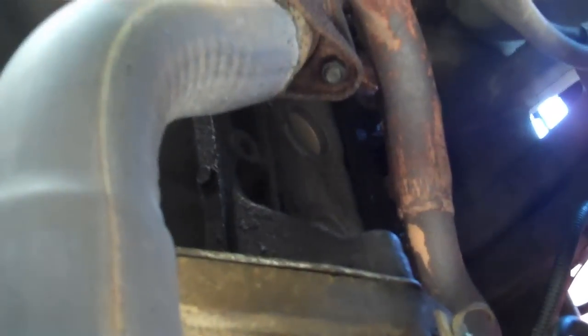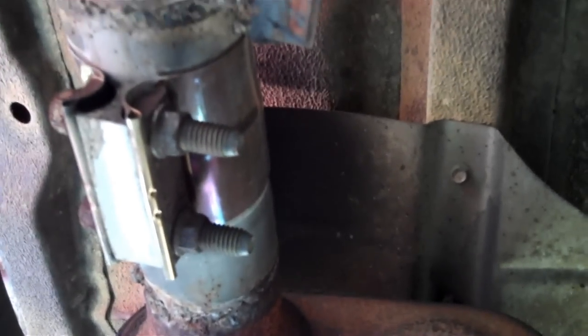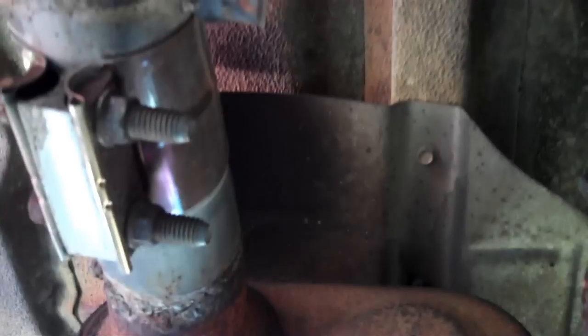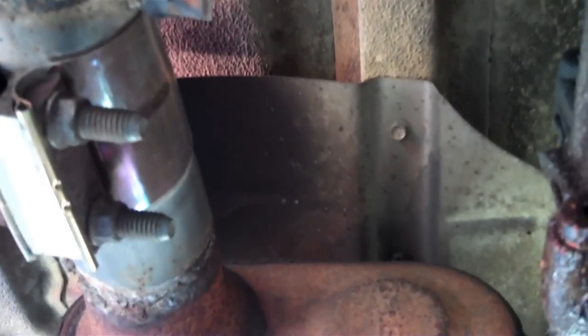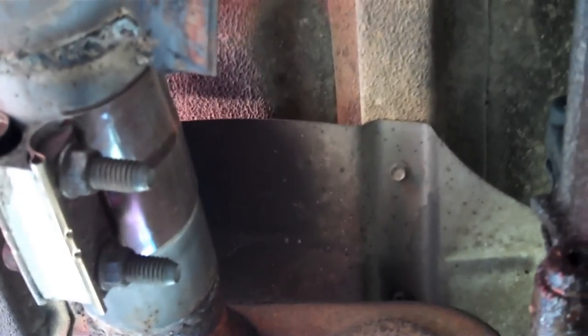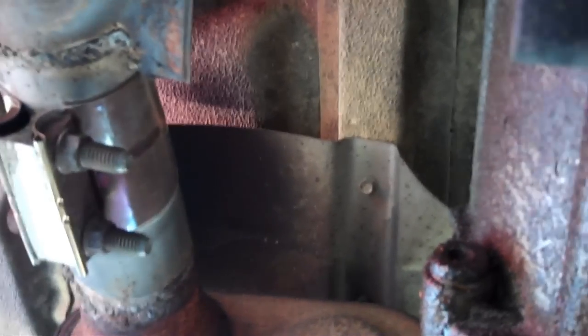Looking at the exhaust — I've got playing room because of the body lift above the tunnel. For those of you who don't have a body lift, go ahead and drop your exhaust. I've got two bolts up here and stainless steel clamps over there — my whole exhaust drops, I unplug my oxygen sensor, and it's as easy as it can be. To save myself some headache, I'm going to go ahead and drop the exhaust. I can't tell you exactly how to drop yours — just look and see where it comes apart.